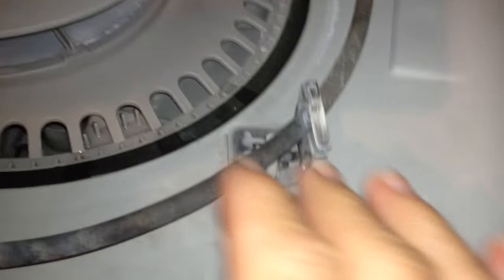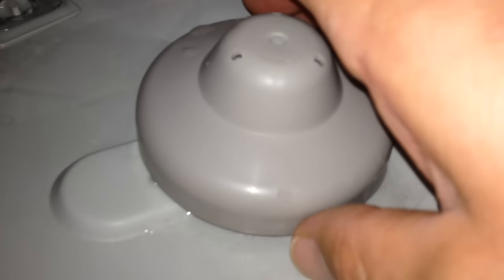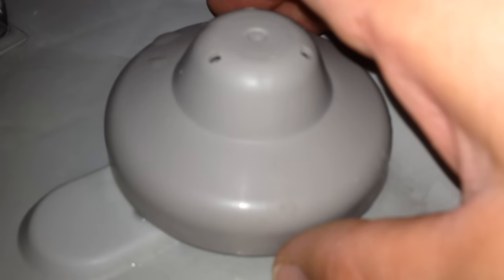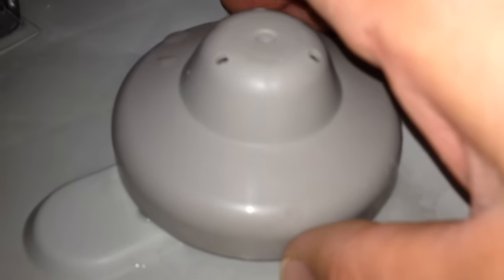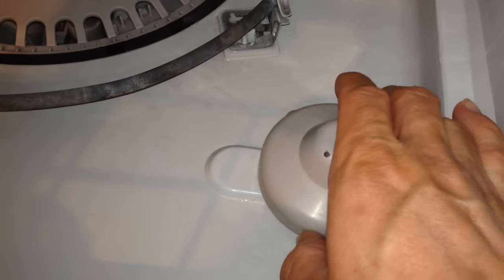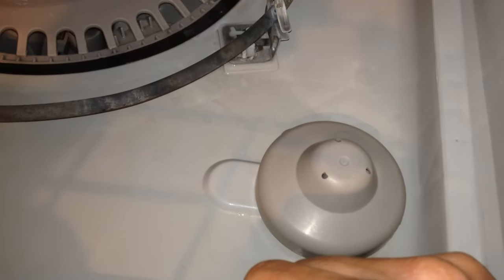Looking in the dishwasher, down here is what's called the float. As the dishwasher fills up with water, this floats and tells the dishwasher to stop adding water. To check if it's working, you can listen for the relay switch click. When you hear those clicking noises, you can tell the switch is good — it almost always is working if you're hearing that click noise.